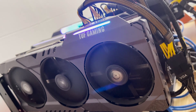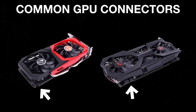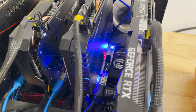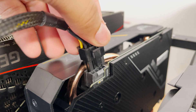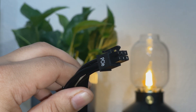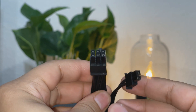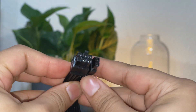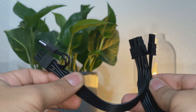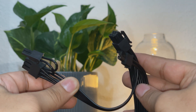Let's start with the humble GPU. On any given GPU, you will find a few different power connections on its side. Your main connections will be single or dual 6-pin PCIe connectors, single or dual 8-pin PCIe connectors, or the weird one 8-pin and one 6-pin PCIe connector. The connectors on GPUs, risers, and PSUs are all female ports, and to power any one of these components, you'll need the accompanying male cable. An 8-pin PCIe connector can be turned into a 6-pin by disconnecting the two leftmost pins — this significantly reduces the max power that can run through that part of the cable. Additionally, you'll often find cables that are daisy-chained to make two 8-pin or 6-pin connectors on the end. This doesn't mean the power doubles, but rather that the power can be distributed across both connectors up to what each part of that cable can handle.